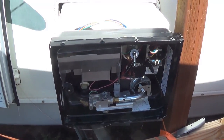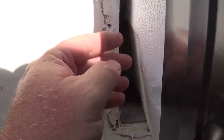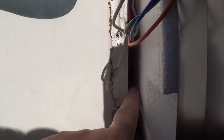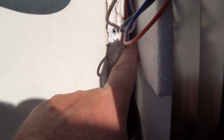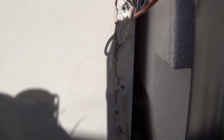I'm going to go ahead and finish pushing this back in, then hook up the propane. When you're putting this back in, I've got these wires routed up high because the propane line is coming in right about here at the bottom. Keep the wires up high and the propane line coming in down there - the reason is making sure these don't get crossed. I don't want them to overlap each other; I want them apart from each other so they don't get entangled. Entangled lines are just an issue, so that's a big tip when putting back your RV hot water heater.